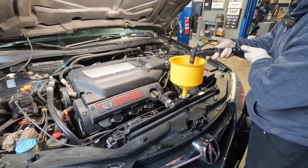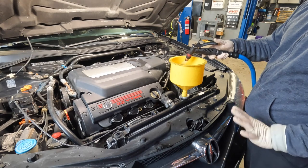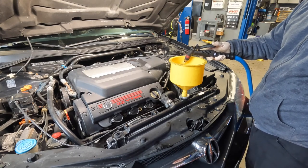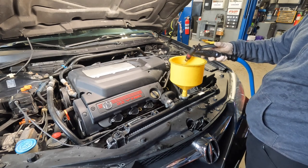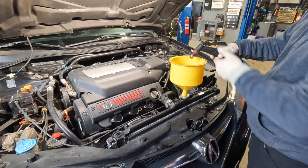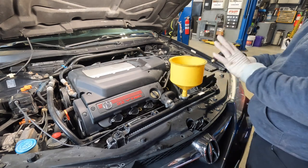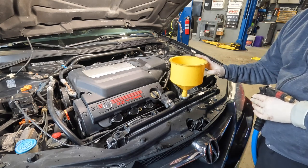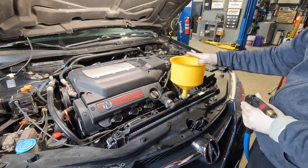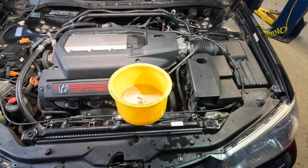Now I'm taking my garden hose to fill up the radiator funnel and get as much water in here as I can. I know you're supposed to use distilled water inside radiator systems, but I read the directions on this product and it just says fill with water — doesn't specify tap or distilled. Since I don't have distilled water, I'm using tap water from the garden hose. I dumped the cleaner in first and now I'm topping it off with water, then I'll bleed the system. If you don't know what bleeding a cooling system is, I have a video on my channel.